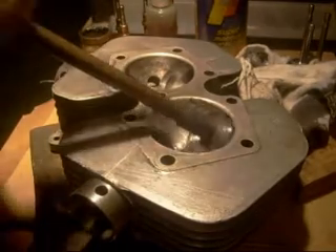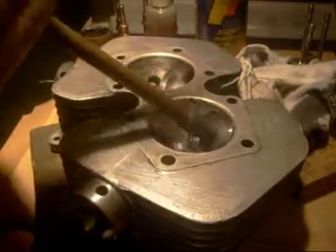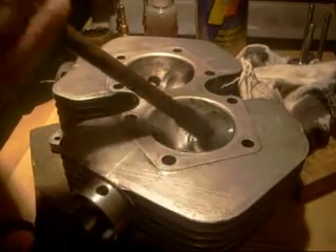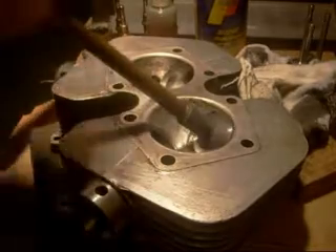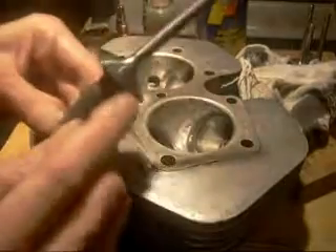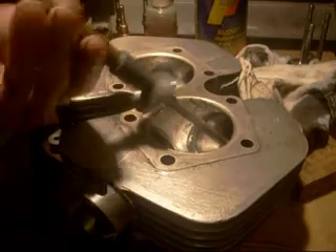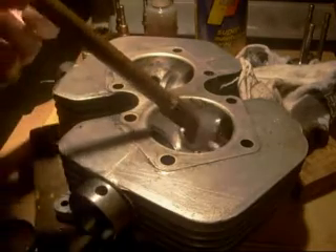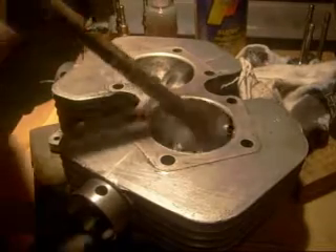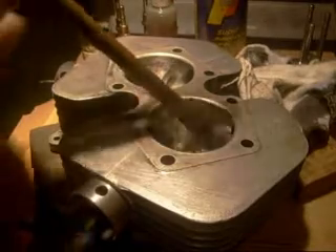Turn it round, lift it out, turn it round. When you tap it like that, the grinding paste ends up in a little build-up on the back of the valve. So when you pop it, it just helps bring that grinding paste back onto the face where you need it. I'll be doing this for five minutes and then blow it again, and that should be the finished job of the valve grind.